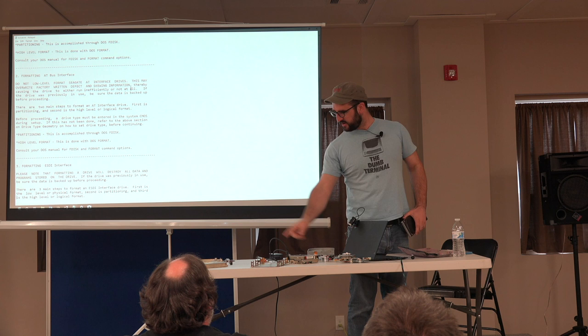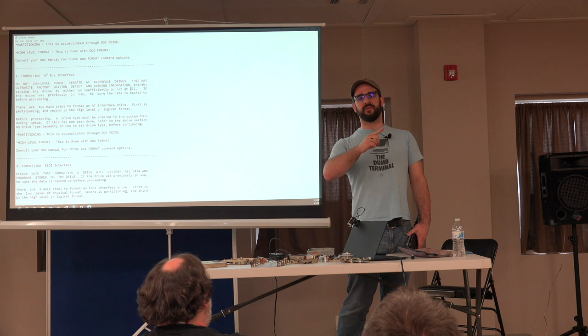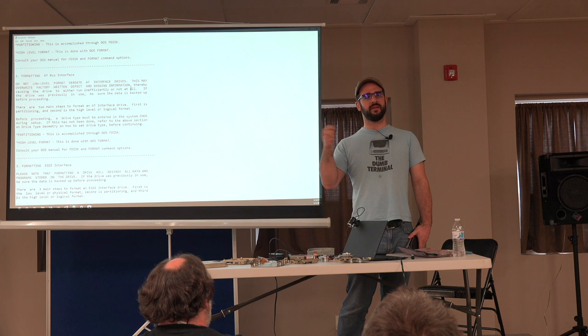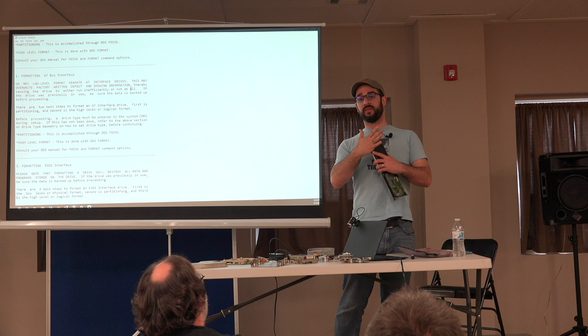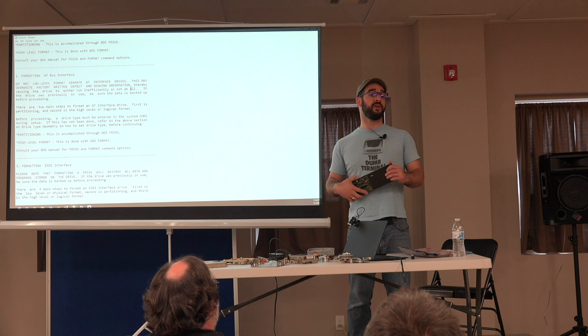These Seagate drives, when you turn them off, they developed a system where the mass of the rotating disk takes the motor and turns it into a generator and drives the head stepper off the disk. So whenever you turn one of these off, you'll start to spin down and then hear this knocking sound. That is actually the head banging into its end mechanical stop, but it is in the landing zone, they call it the parking cylinder. That makes the drives last a lot longer, especially if it's in something that you're going to be moving around.